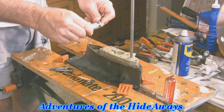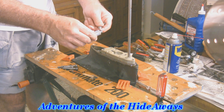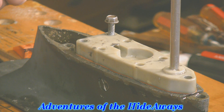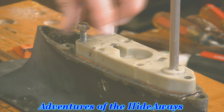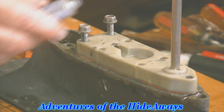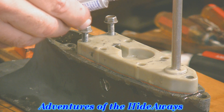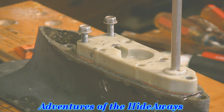I'm getting some of the anti-seize on here. These came out real easy, and I noticed there was some of this anti-seize on it — that's probably why it worked out so good. I'm just going to get all three started. This is one of the ones you need to be careful of. We're going to torque it, and you need to go look that up as to what that's supposed to be for your engine.